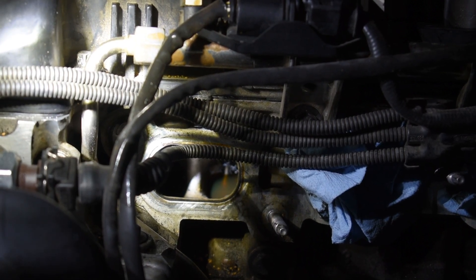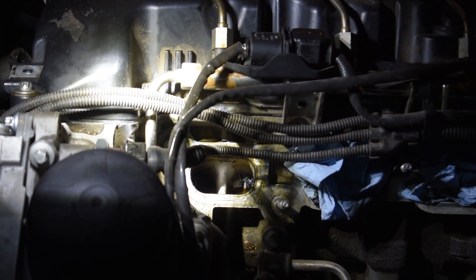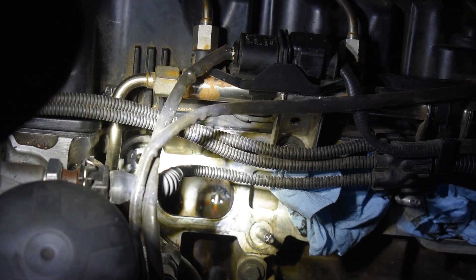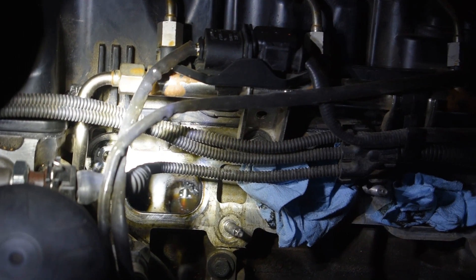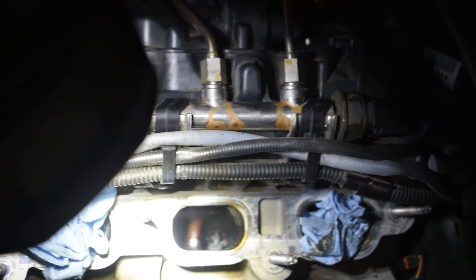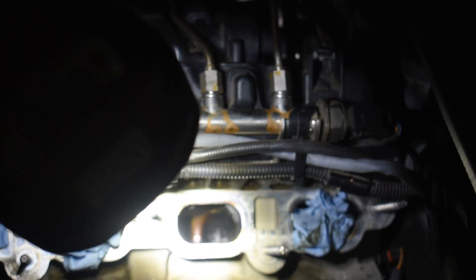The other thing we're doing right now is working on walnut blasting the intake valves here down on the floor behind me. We've got our shop vac, the air compressor, the walnut shells, and the gun and everything. We went ahead and knocked out cylinder number one — this was the worst one and was pretty gunked up, so we cleaned it as much as we could. Now we sprayed brake cleaner in there, we're going to let that sit for 30 minutes or an hour, and then come back and try to clean it out with a shop rag to get it as clean as possible. In the meantime, we're moving on to cylinder number five, since number five is closed at the same time as number one. Cylinder number five is definitely nowhere near as bad as cylinder number one was.